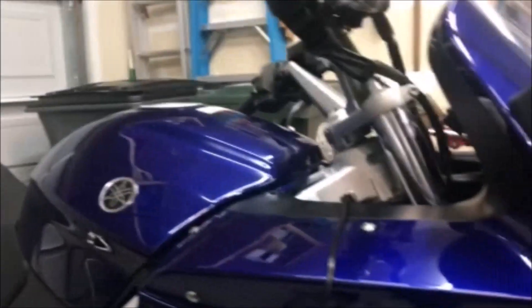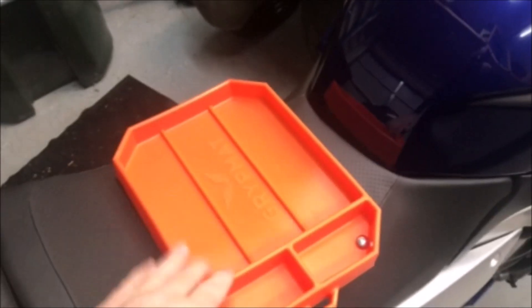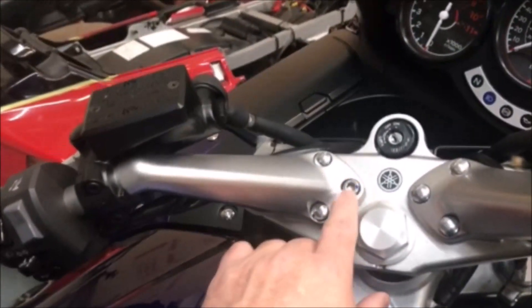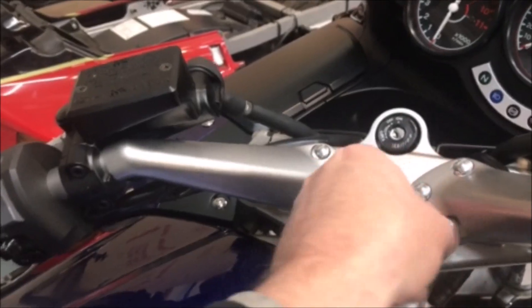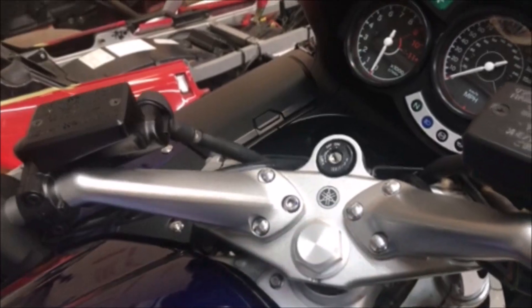Next up are the bar risers. My wife got me this little rubber mat kind of thing that will sit and stick so you can put your stuff on — like these little caps. These are little plastic caps on top of the hex bolts on top, so I pluck those off and now I've got somewhere to put them so I don't lose them. Then I'll use some hex keys and lift these up. Pretty straightforward — little six millimeter hex bolts, they plop right out.